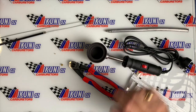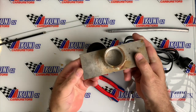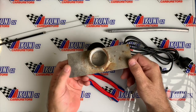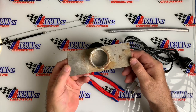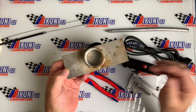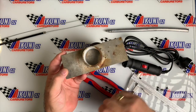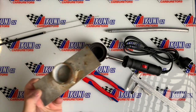Now at home, obviously you don't want to be spending the expense of buying a pot, but if you do potter around with old motorbikes and you're going to be doing cables from time to time, this is something you can make up at home. Just a bit of pipe welded to a bit of flat steel, and in the shed you can put this on a little gas burner, or even go into the kitchen and put it on the cooktop and heat it up — that'll melt your solder. You just dip your cable in your baker's flux, then dip it in the solder and the job's done. Really tidy job, a lot better than trying to do it with a soldering iron. So that's something you can simply make yourself at home.